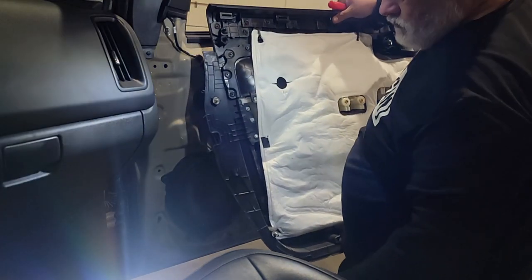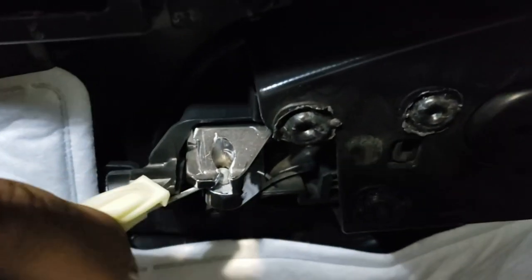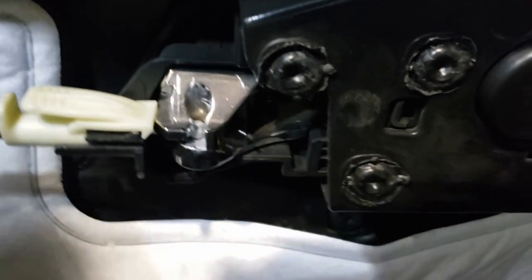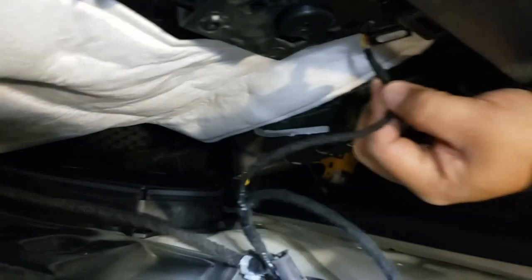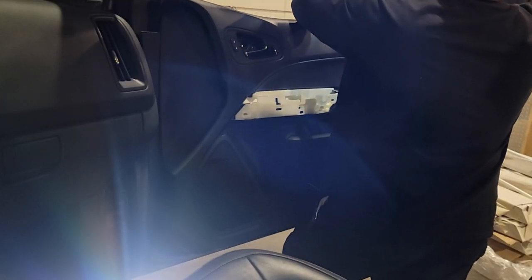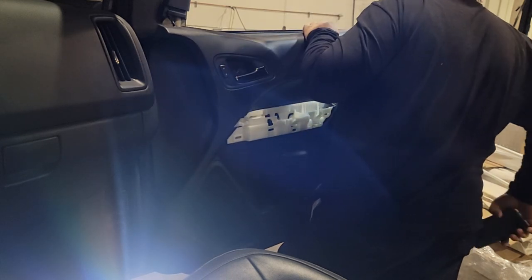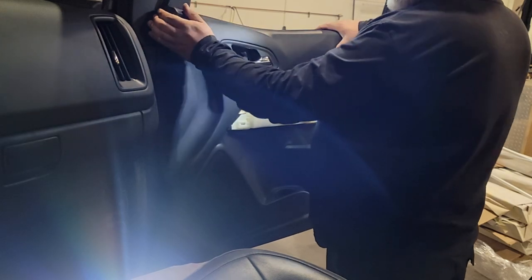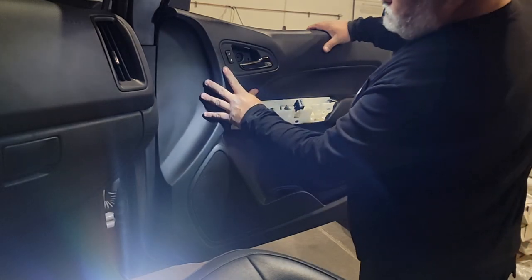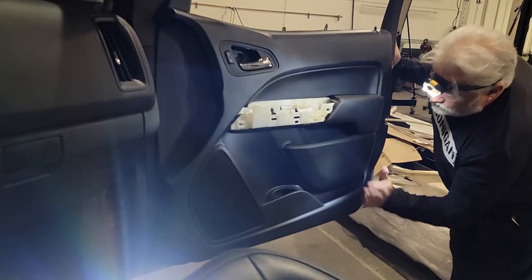We have the upper clip and that middle door jamb white clip I pulled out near the outside edge of the door. Now we can reconnect the cable that attaches to the handle: drop the ball in the slot, pull that neatly across the back, and push the clip until it completely locks. For the lock and unlock, simply align that and push it into place, then hit the lock mechanism. Make sure the window switch cable goes through the hole in the door and comes out the middle. Don't forget the lock rod that has to align through its rubber grommet — slide that through the hole. Once set up, align the front edge, apply some force to get all of those pops to align, and lightly tap around the door to make sure each pop locks the panel in place.